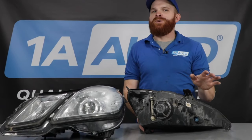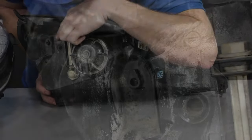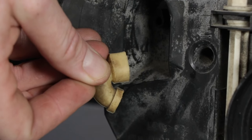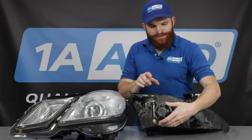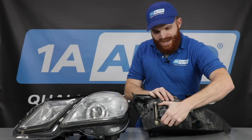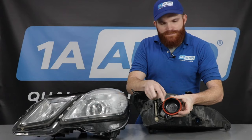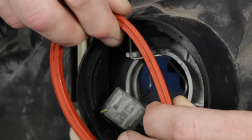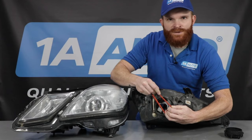So let's talk about the backside of these lenses and where they could possibly leak a little bit of water. Of course you have your vent areas — that's one thing to think about, super important. Generally speaking, you should have something over it, maybe like one of those vented caps that'll keep water from splashing right up in there — one of those little tubes that goes down, to help keep water from splashing in. This right here is a kind of poor design and it could be a great cause of why there'll be so much water inside this lens. Another thing you need to think about is the areas where your bulbs are supposed to go in. These caps generally speaking should have a rubber seal of some sort — this is super important. This one looks really good while it's on the cap, but you take that and give it a little stretch and you can see right here where my finger is — this is not in great condition at all. Moisture can work its way right inside here and it's going to fill up that lens easy peasy.